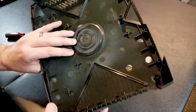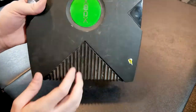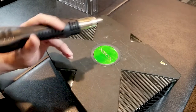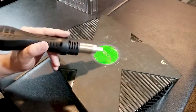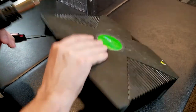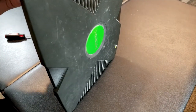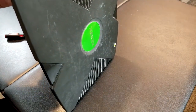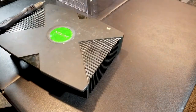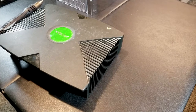As you can see, there's no screws or snaps or anything accessible from the bottom, so it looks like the badge is just held on with glue. What we're going to do is use a heat gun to heat up the bottom of it and hopefully get it to disengage. Let me see how far my heat gun reaches — well, it reaches infinitely far if I don't have it plugged in, so let me get it plugged in.